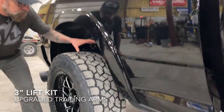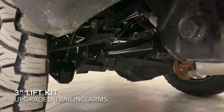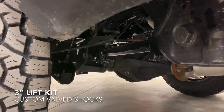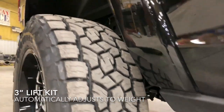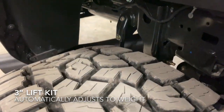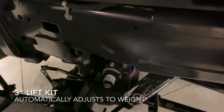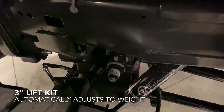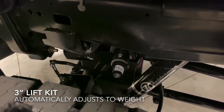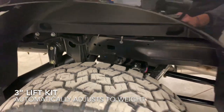With the 3 inch lift we replaced the factory trailing arms with our heavy duty Kelderman trailing arms. We've got our Raptor shocks, and you can see the sensor here for our AirLift 3H control. With the airbags we are not decreasing the load carrying capacity whatsoever, so he's going to be able to put that big livestock trailer on here, load it up with his animals, and keep this truck level — which is going to give him a good ride and really good handling when he's running all over Wyoming.